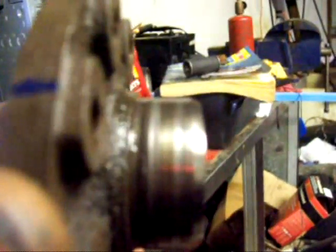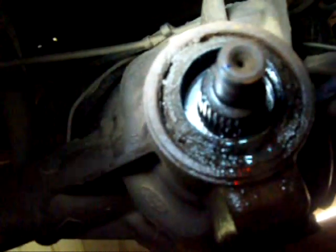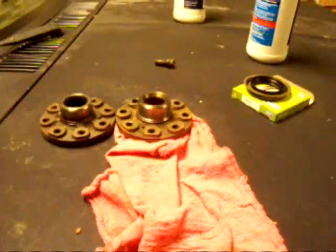I've got the nut and the flange off. Looking at this thing, I'm pretty sure you can see it on camera — there are pretty big grooves, and I'm not liking that. There is a parts ranger I can steal parts from if I need to, so I may go down there and pull that one off and see if it's any better. Here's what it looks like when it's all taken apart. I've got all my lines still lined up, so we're good. I'm gonna yank that sucker out and hopefully get a new one, and if I have to I'll get another flange.